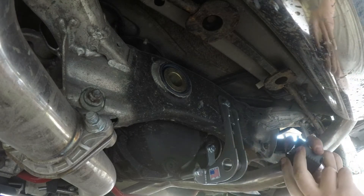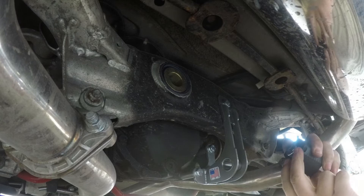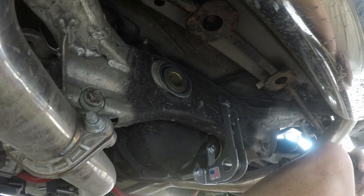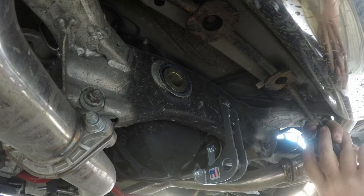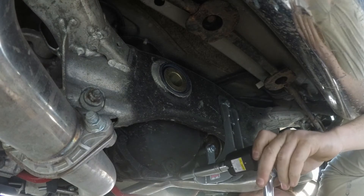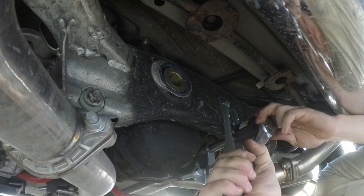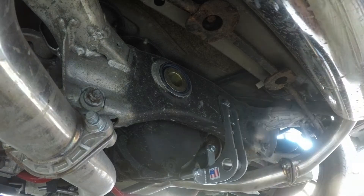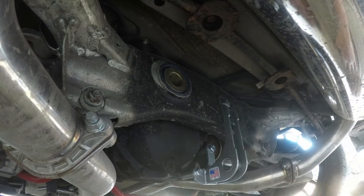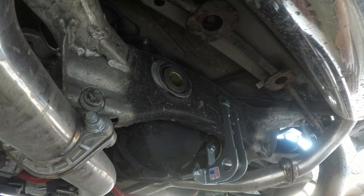Now grab the torque wrench. I've used these a lot and I love them — there's actually a guy who tested these and showed they're just as accurate as a mechanical Snap-on torque wrench. The torque spec for the diff cover is 32 foot pounds. You don't necessarily need to torque these down, but I'd hate for it to start leaking. And that's all it takes to install your Bell Raceworks Z1 Motorsports style diff brace. Now I'm no longer worried about breaking this bushing, which is awesome. Let's take it for a test drive.